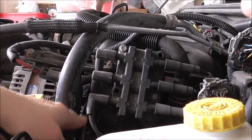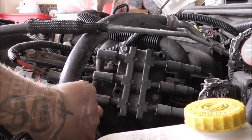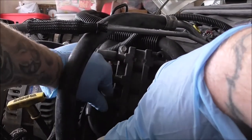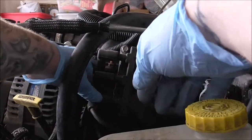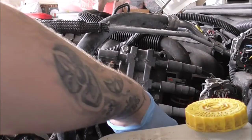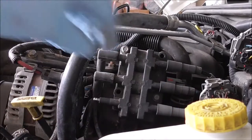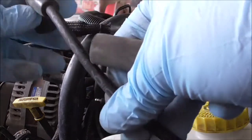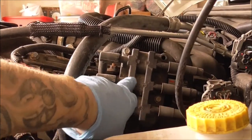I'm going to start at the bottom — this is the longest wire on this side. I'll move this top one loose first, just like that, and it pops off. On the bottom ones, you don't want to pull on the cord — you want to grab the boot down there and pull from that. You can see these are the originals — Mopar. They're actually labeled by number; you can see number six on there.